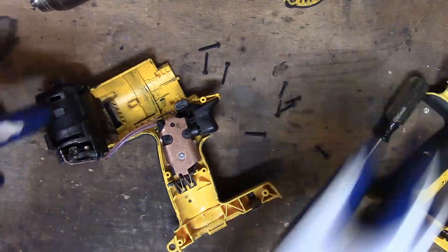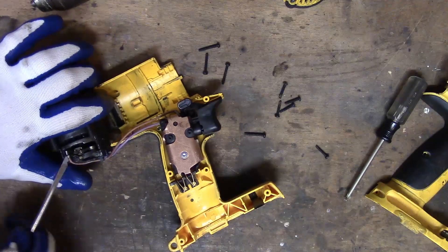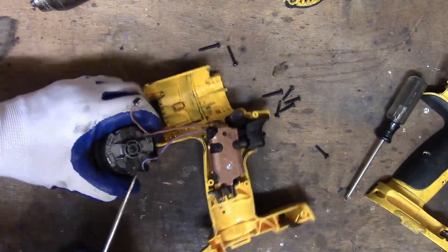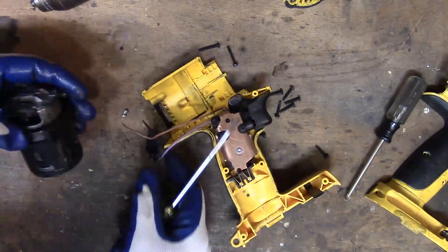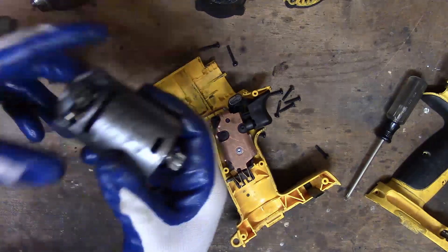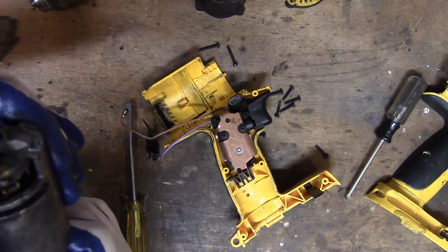Now aside from that gruesome story, let's see if we can't get these little contacts out. Get a screwdriver — it's got these little stake-on terminals. There we go, there's one. So red's on the right, and this gray one — get that off of there. That plate comes off with it. So this little plastic piece — there we go. There's the motor. That's what causes all the noise. I can feel some cogging in it, so it may be a deal where I just have to replace the brushes.